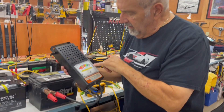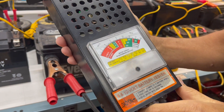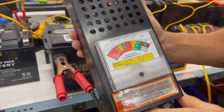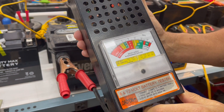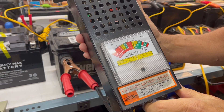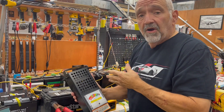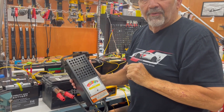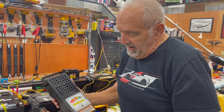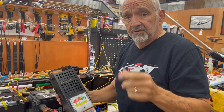So I've taken the carbon pile load tester. Without a load on there, it's in the proper range. Here's the big deal — when I put a load on it, it's still in the green. It's a little weak, but it would be usable, certainly on any kind of small vehicle. It's not new, but it's 14 years old. So from a $2 dead battery that's been sitting around for years to a battery that can hold the charge and is still in the good range even with the load on there — that's what pulsing can do to a battery.